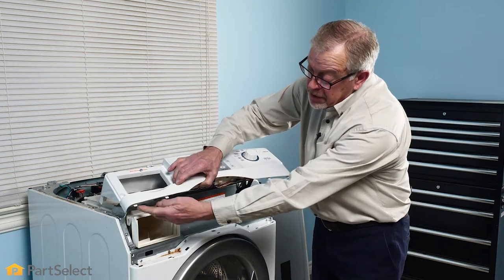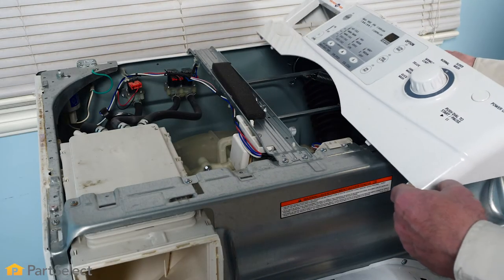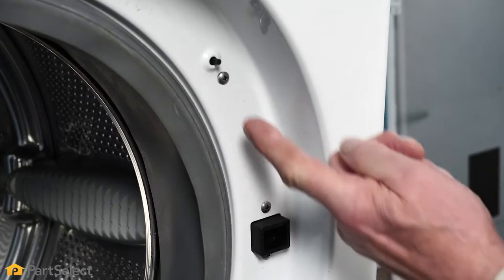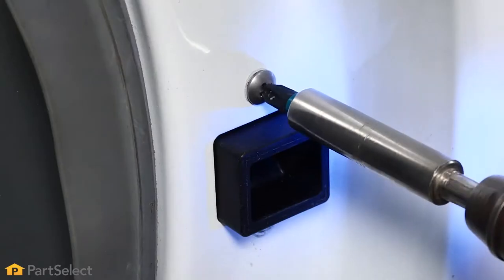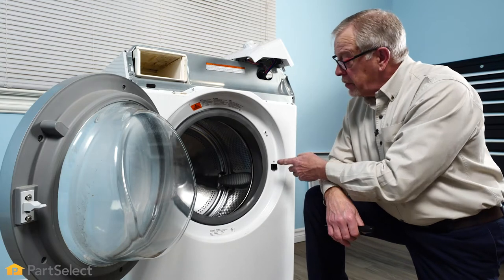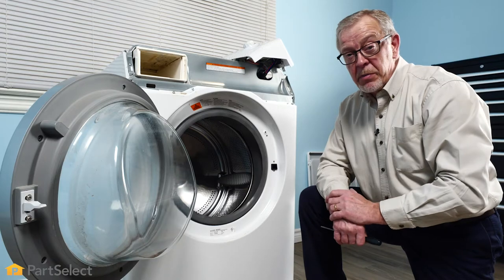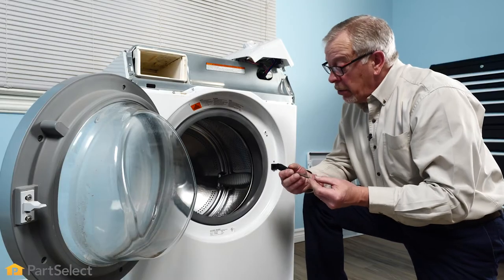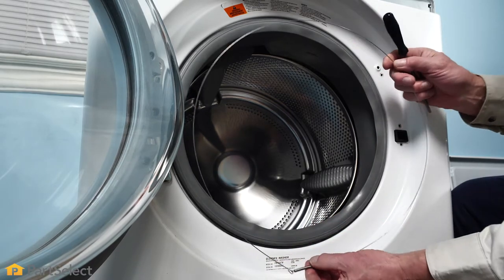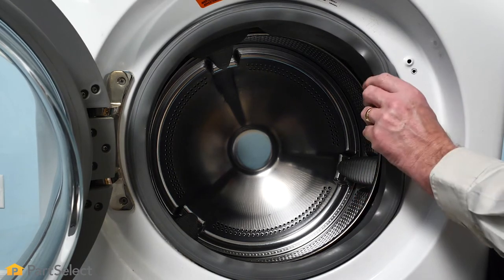With the console disconnected from the top of the front panel, there's typically enough wire harness that we can just rotate it out of the way and let it sit there. Next, we need to open up that door and remove the screws that secure the door lock switch assembly to the front panel. Our next step will be to detach the existing door bellows from the front panel. They're typically held in place with a wire clamp that runs around the perimeter of that bellows, with a spring in the six o'clock position. The easiest way to remove that band clamp is with a flat blade screwdriver — carefully go in between the bellows and the spring and pivot it out to release the tension, then lift it away from the bellows and set it aside. The profile of that bellows is matched to a V-groove in the front panel, so we need to pull that out all the way around.